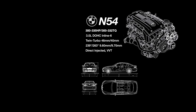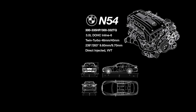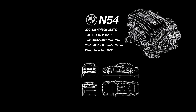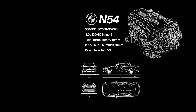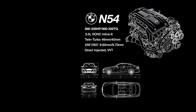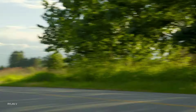In 2006, BMW produced their first mass-produced turbo inline six called the N54. This was an engine offered in the 335i initially and then proliferated throughout BMW's lineup by 2008. It was an all-aluminum three-liter dual overhead cam inline six with two TDO3-10T turbochargers making eight PSI boost for an overall output of 302 brake horsepower, and later produced up to 335.